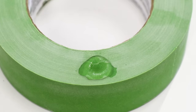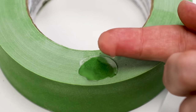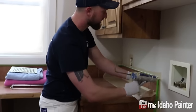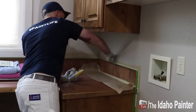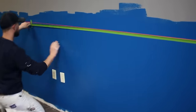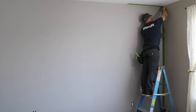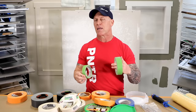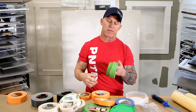It's a polymer that actually swells up when water hits it. If you put a drop of water on the tape, you'd see it swell up — it's the same technology that goes into diapers. It swells up and doesn't allow liquid to go underneath the tape. That's what we use to create laser-straight lines. We use it a lot now — we buy it by the case, and every vehicle has multiple cases of this product. We used to use it sparingly because it was expensive, but we realized quickly that the results far exceeded the cost.